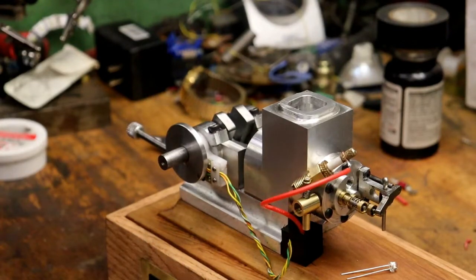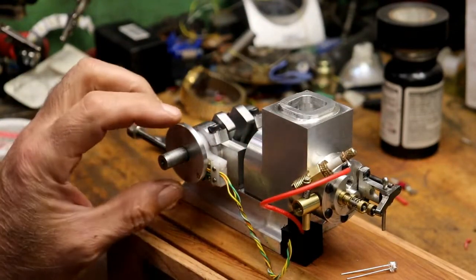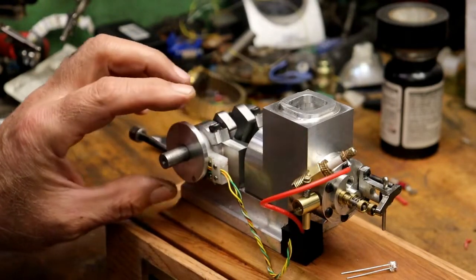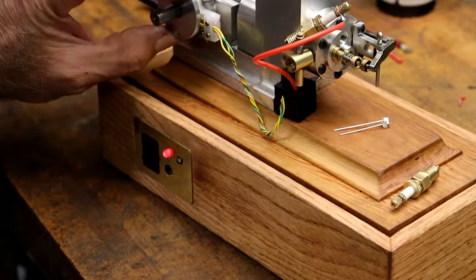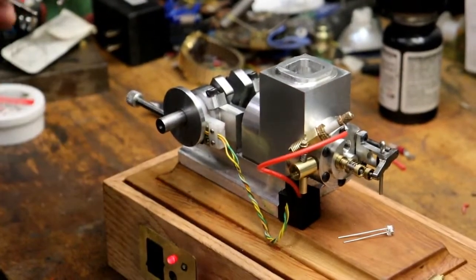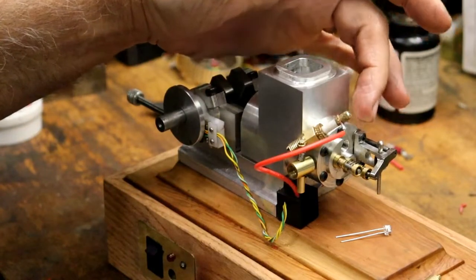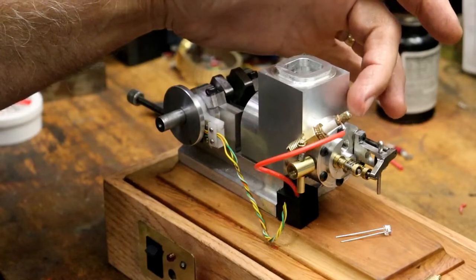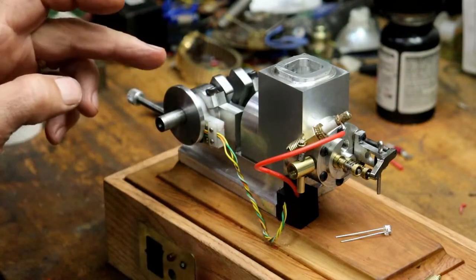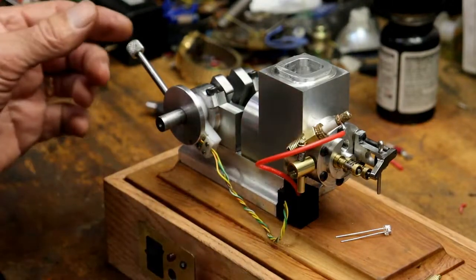Okay, I have the plate in there and all wired up. So if I turn it on, I got the spark plug hooked up here. If I turn it on, rotate that around. You should be, oh, you can't see it. There we go. And what's left on the motor itself is to set that, but I won't do that. I'll turn this off until after I put a head gasket in. I haven't put a head gasket in this yet. I got to put the head gasket in, set the push rod length after that, make sure the cam is in the right position, and then get the timing for the timing disc here for the ignition close to the right position, because then I can adjust it from there.